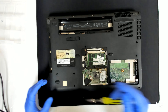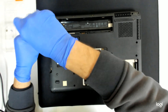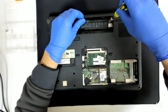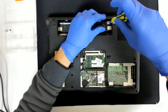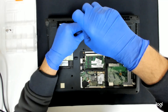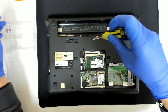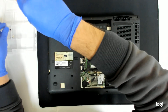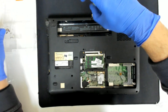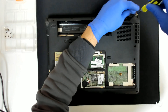We are going to remove all the screws on the back and flip the laptop. That is the boring part with the screws — you can skip it if you like. The screws around the battery are a little bit shorter than the other ones, so keep that in mind.